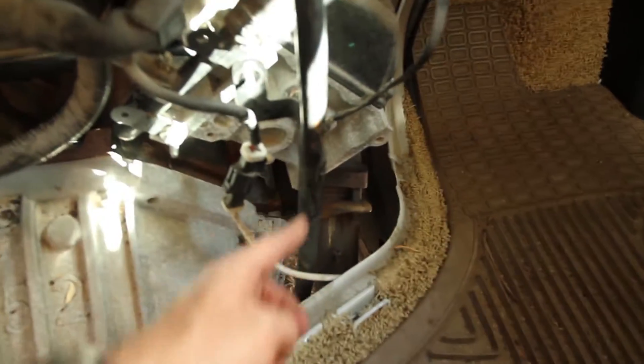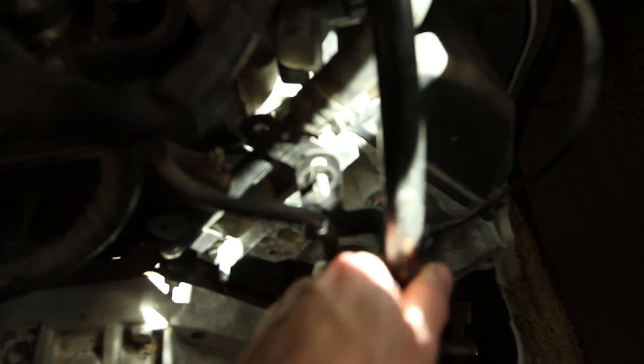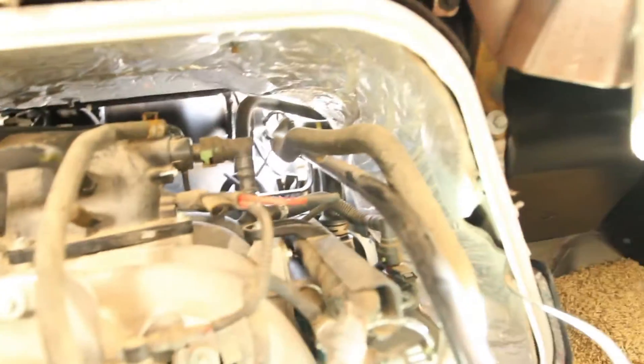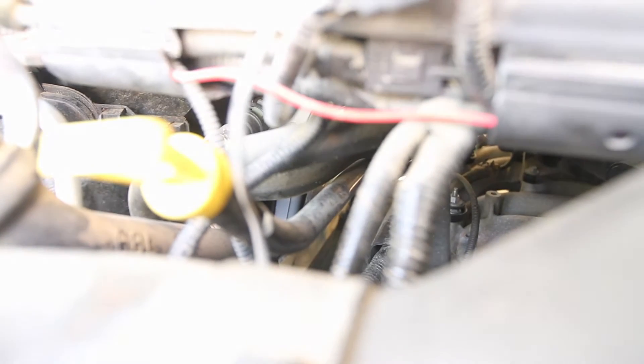You can see in here where the upper tube mounts into the lower tube — there's just an o-ring, it just presses in to fit. To get that out, we need to remove two 10-millimeter nuts. You can see the first one here — I've already got it disconnected. The second one is down there; it's best to get at it from the other side, under the hood. You can see it just on the right.